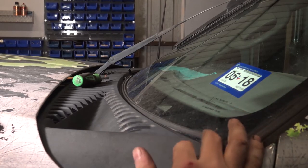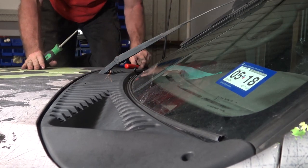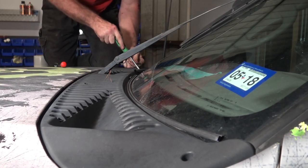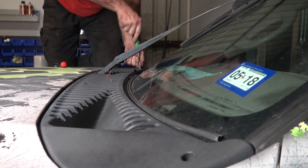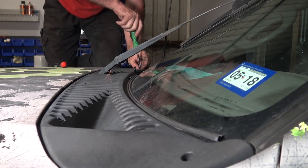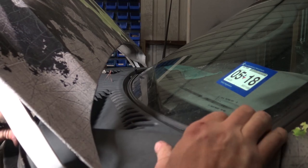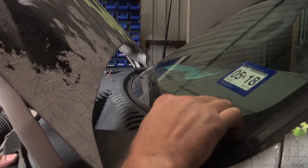I'm going to take all these little screws out and take that other wiper off. Normally you wouldn't have to take both cowls off, but I do remember I had a problem with the washer nozzles on this. I was trying to blow them out one day with an airline and I ended up disconnecting them in here and never fixed it. Now we have everything loose — you have to pull them up a little bit and slide them forward.